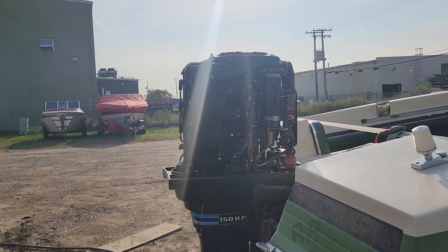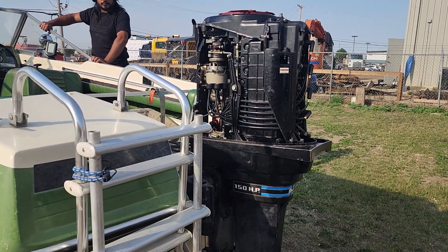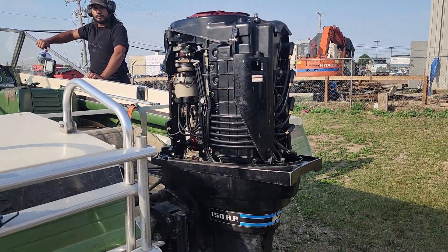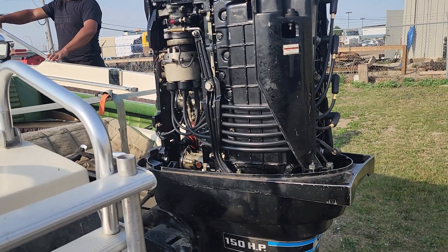It's getting plenty of fuel, so we need to figure out what else might be happening. Because this is an inline six, we don't choke the bottom cylinder. So we still got one more test to see if that bottom cylinder might be running lean. We're going to repeat that same thing without activating the choke — I'm just going to restrict a bit of the flow at the bottom here.